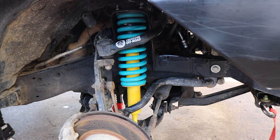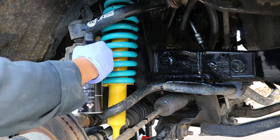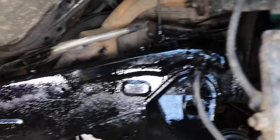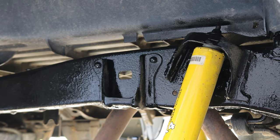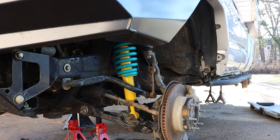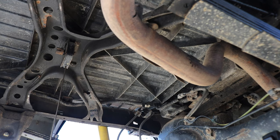I'll start by spraying the inside of the wheel wells with a really thick first layer. It is a little bit runny, so keep that in mind. I used a rag to clean up any overspray that got onto the yellow shock absorbers — when you spray it, it splatters a little bit, but as long as you wipe it down quickly it shouldn't stick to anything you don't want coated with the black wax coating. Now let's do the same thing on the opposite side and then make my way under the bed, hitting all the areas there.